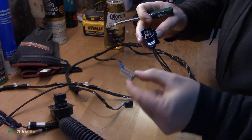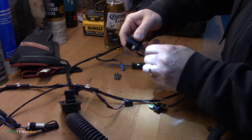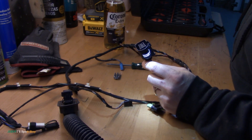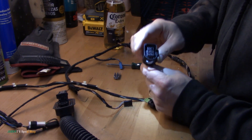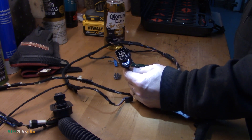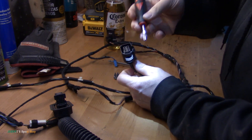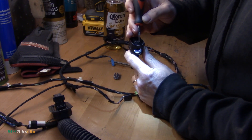So that's your wire lock. So these wires, they're still pretty solid. Grab yourself a de-pin tool. This is a BMW — I can normally tell by looking at them what I need. These are pretty small. This is number 23 out of my kit, which I believe is for Opel Vauxhall, but it works great on BMWs too.